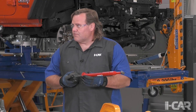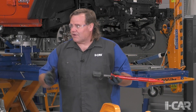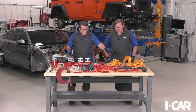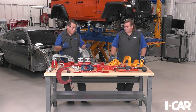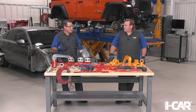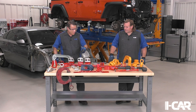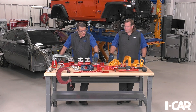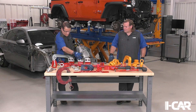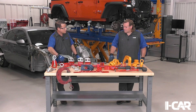You can also stay away from the chains — that's why I like the big ones. I'm not getting in there with a hammer right next to the chains worried that something's going to let loose. I can stay a few feet away. The larger slide sledges will give you a workout, but they're definitely better than climbing underneath the frame machine and being up close when you're trying to stress relieve something. There are a variety of different feet or ends that can go on the slide sledges — a few of them can adapt right on, whether it's the shorter one or the longer one with the extension.